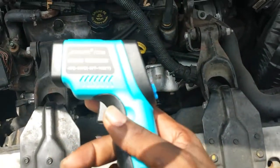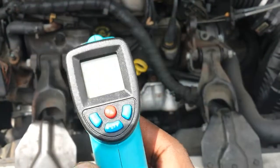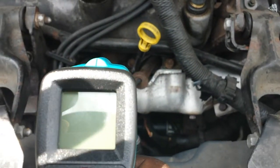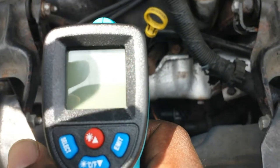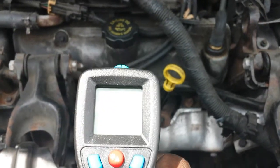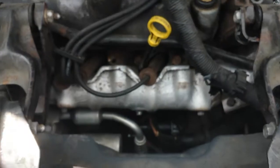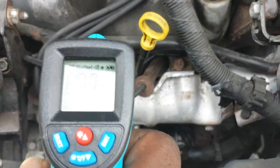This right here is your infrared thermometer — it's going to read the temperature. You don't want to point this at your eyes, as it can cause damage. What I'm looking for is a temperature between 195 and about 225°F. You definitely shouldn't see anything like 300°F, as that would indicate your engine is overheating. I'm reading in Fahrenheit, and I'm picking a spot on the engine down where the spark plugs are, and I'm going to shoot it and measure.